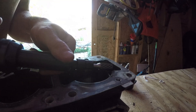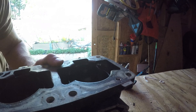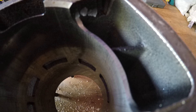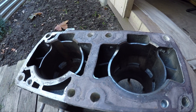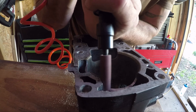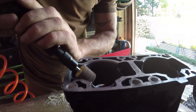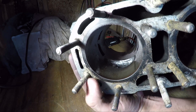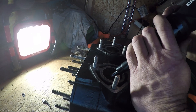The amount I removed from the cylinders was minimal, and I mainly focused on chamfering and polishing the edges where air has to break over the walls. During this process I alternated between carbide burrs, sanding cones, and flap wheels. On the intake side, I kept the polishing to a minimum, since some turbulence is good for the mixture of air and fuel. I could have done a more extensive job in the center of the cylinders if I had a low-profile pencil grinder. Instead, I just rounded some of the edges and focused more on the areas I could reach with my straight-end grinder.